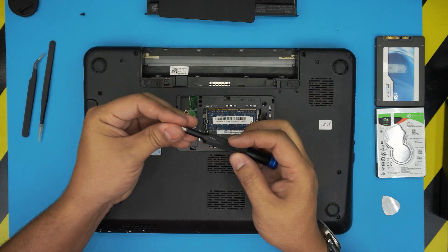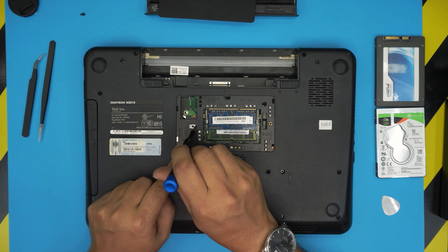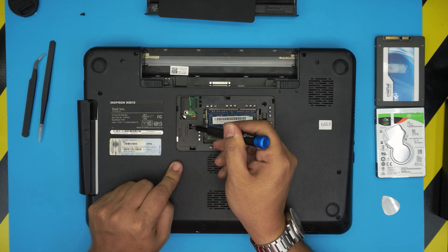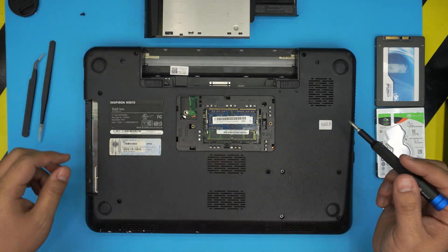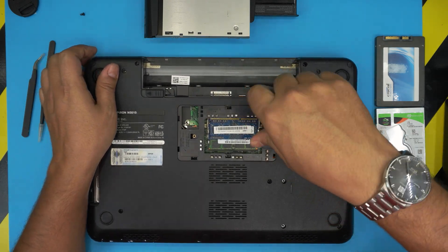Be careful when you remove the DVD drive — don't yank on it. That's why there's a hinge right there. Put your screwdriver right there and pull it this way so the DVD drive comes up much easier. Next, we're going to remove the screw right in here under the cover.